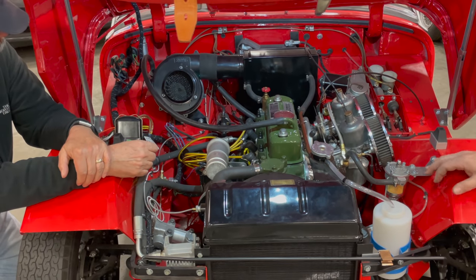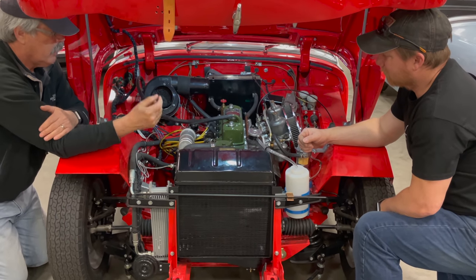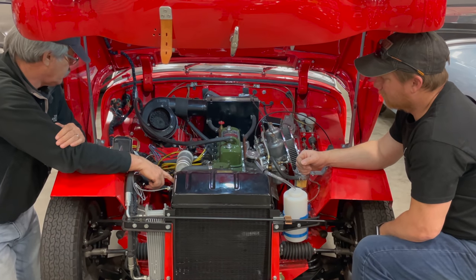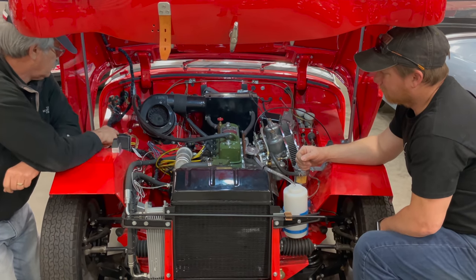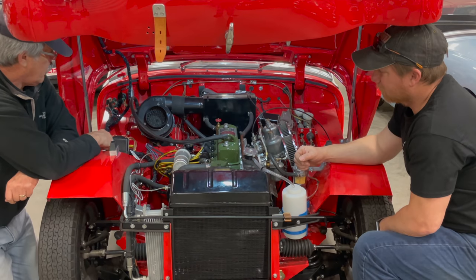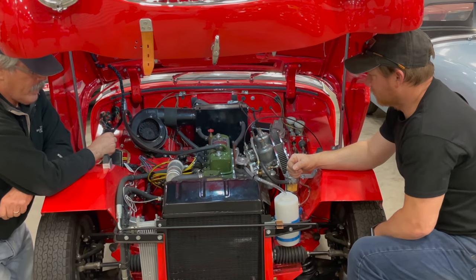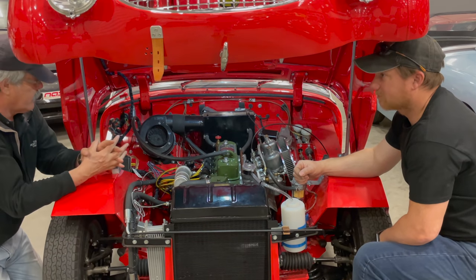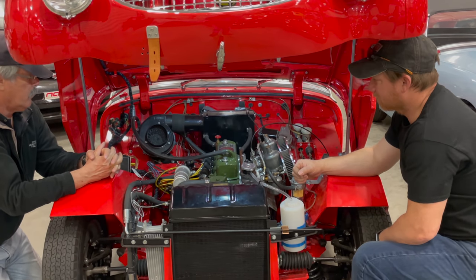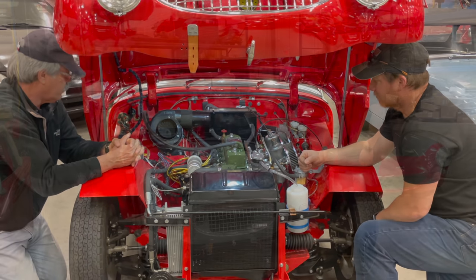There's still a bit more work to finish sorting out. They were using a slightly larger generator and we're trying to get those built, along with an aluminum housing voltage regulator — all trying to get a little more amperage, since running lights, wipers, heaters, and accessories in such a simple electrical car could overdraw the circuits very quickly.